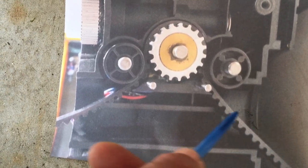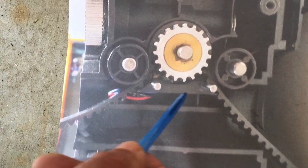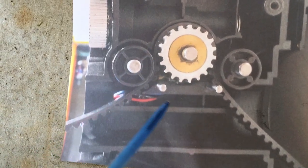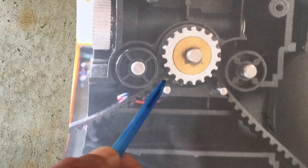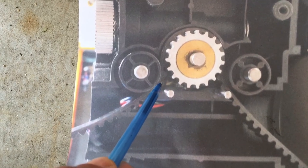This is a picture of what it looks like inside. Minn Kota was nice enough to send this to me. I did not take my motor housing apart. This is where the shaft goes right in here. With your fingers, feed the belt under this plate right here and around this gear. The difficulty I had is that the belt kept going in sideways, and it went a lot easier upside down. When it comes in through here, it doesn't come up this groove and come out again.